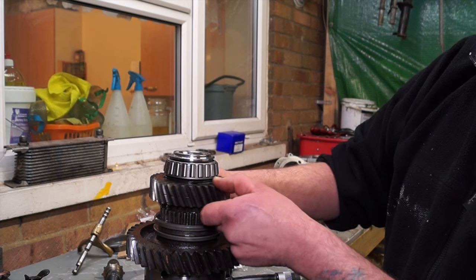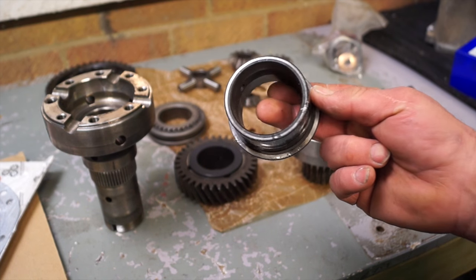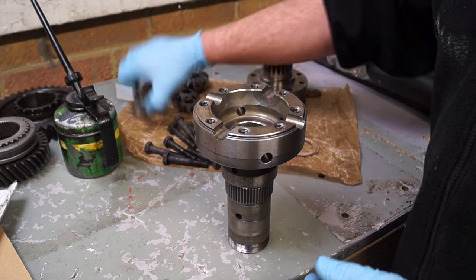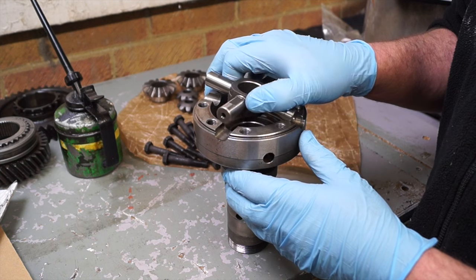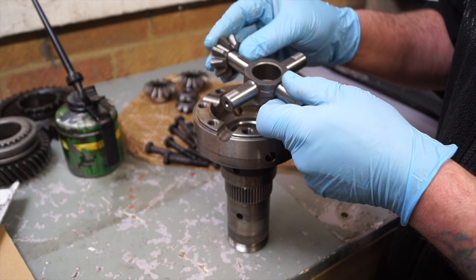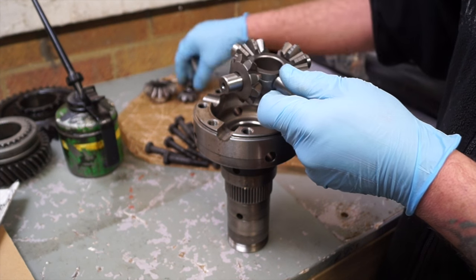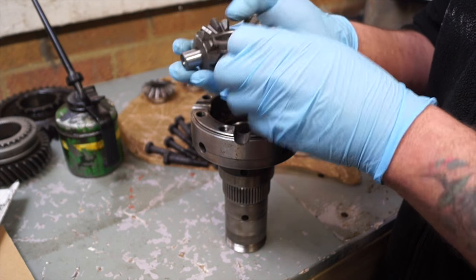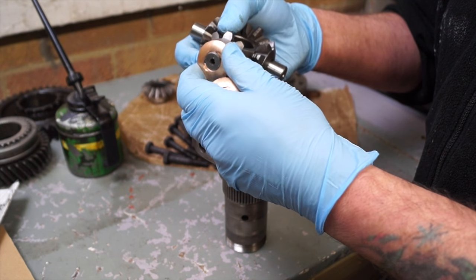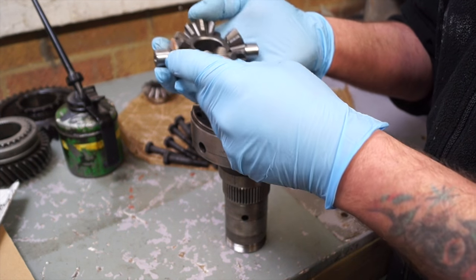Just to show you here with the component assembled — nice and smooth, and next to no play whatsoever. Always keep bushings like this for your press, just in case you need them for pushing something in. Assembly is kids' play. You have a cross pin like so — be careful because once it's in place you'll probably need a screwdriver to prise it back out again. So we'll assemble our gears into place. These little planetary gears and this shape that Ashcroft have designed — you'll actually find this in heavy goods vehicles' rear diffs. This is a stronger design.